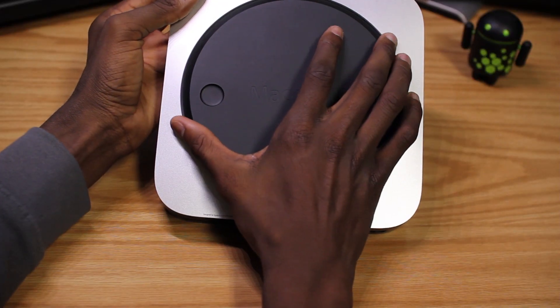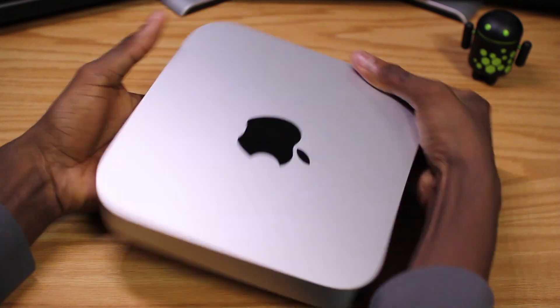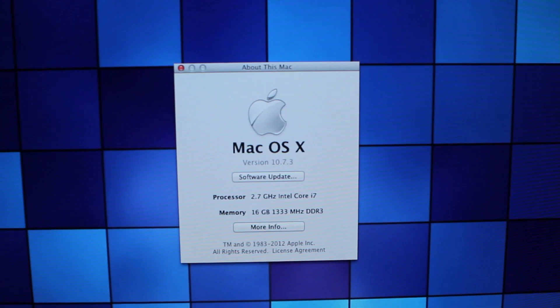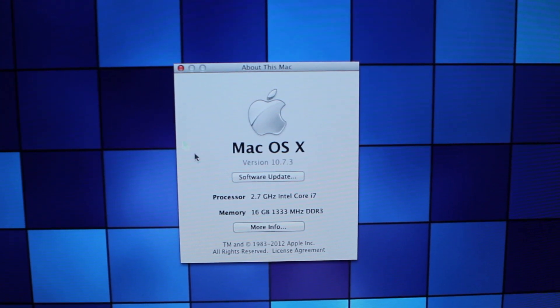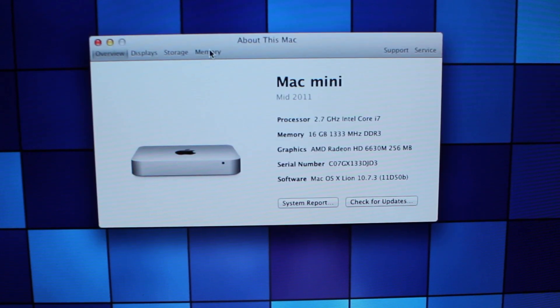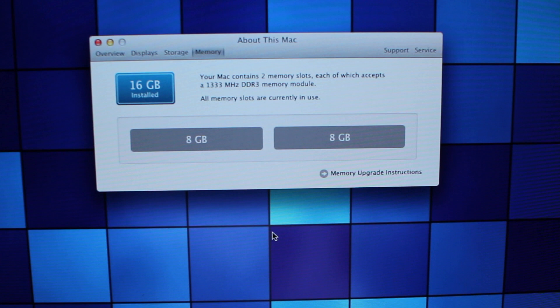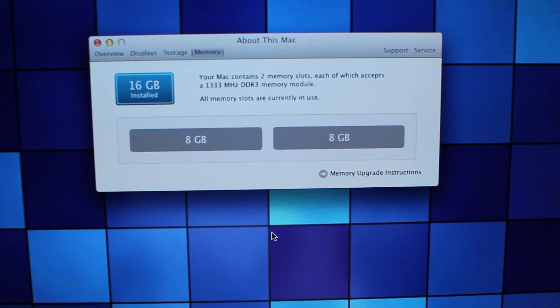So you can put the back cover back on the mini and boot back into Lion. Once you've booted back up, if all goes well, you should be able to go straight into OS X and hit that Apple logo in the menu bar and click About This Mac, where you can confirm that your memory total is now 16GB. And if you want further proof that both of your 8GB DIMMs are working, just click More Info. Under Memory, you'll have a handy-dandy little diagram for you. Your 1333MHz random access memory is now in full operation.